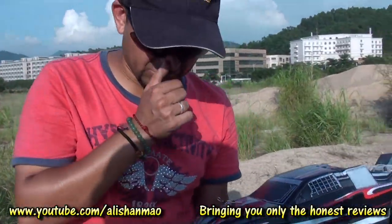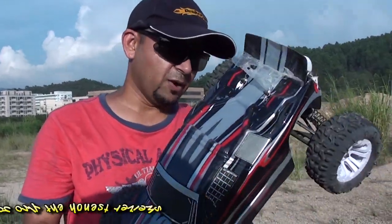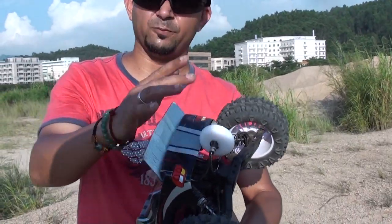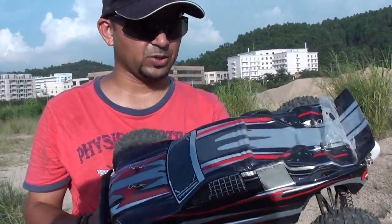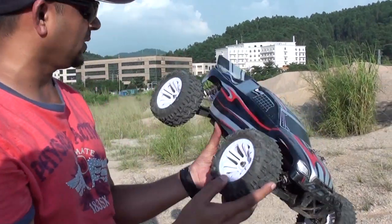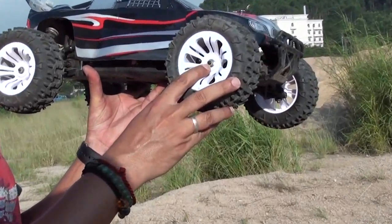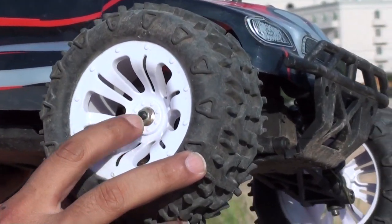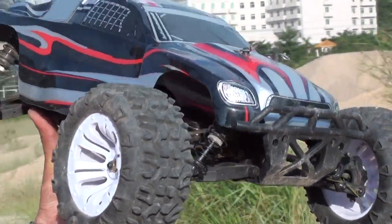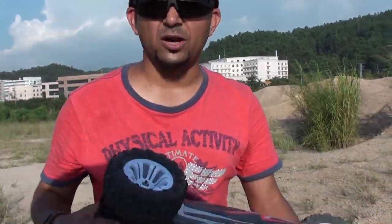Okay, little truggy — we ran it on a 7.4 volt LiPo but it wasn't that powerful. Now we are running it on 11.1 volt and you can see we needed a wheelie bar — it was pulling wheelies and doing awesome high jumps. I'm loving it. Apart from a few things, everything is just sweet about this truggy — it's durable and everything. Just these screws — I think they need to be either lock nuts or we need to use thread locker, because in this five-minute run I think we have lost two of them.